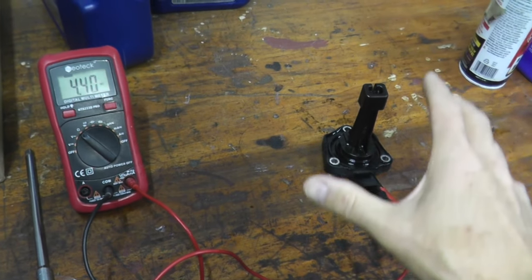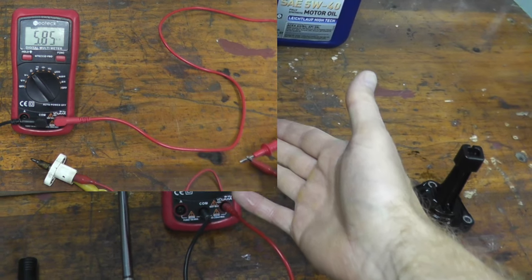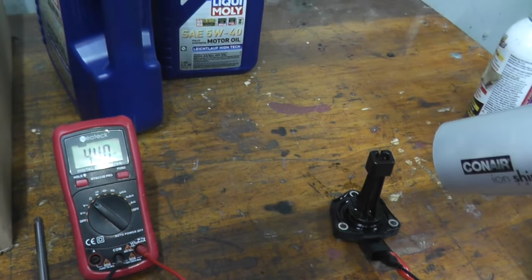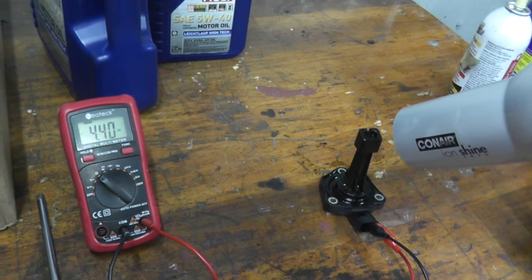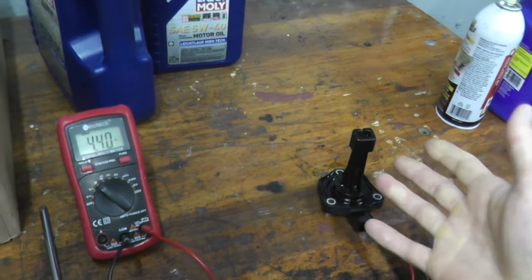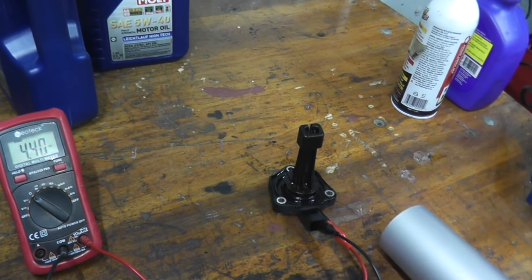I was thinking — is there a way to test this sensor? With coolant temperature sensors and air intake sensors, you can quickly grab a multimeter, set it on the ohm setting, apply heat to it, and typically the resistance will change. But here, nothing is happening whatsoever. It could simply be because it's not getting hot enough — engine oil gets very, very hot. Even in the Audi service manual, there's no clear way to test them. It simply says if you need to replace it, this is how you do it, and that's it.